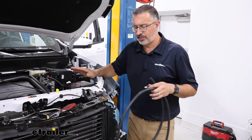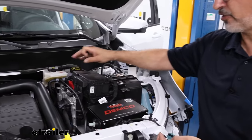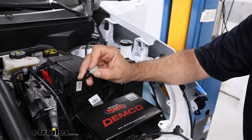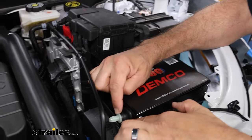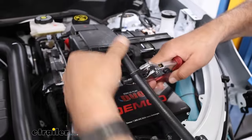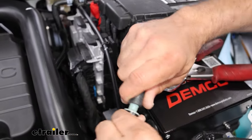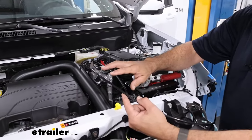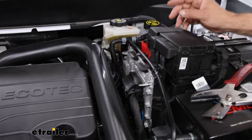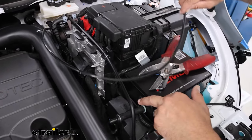As far as the plumbing connections on our supplemental braking system, it's pretty straightforward because we have an electric assist — not vacuum assisted — and the battery remains connected. In your kit you're going to get a check valve. We can either turn the check valve around that's on the main operating unit, which can be difficult, or use the check valve that came in our kit, cut off a section of hose, and reverse it — you want the black facing towards the outside. The other plumbing connection uses the included quarter-inch nylon tubing. I ran this back to the firewall at the same location we ran our wires out for the g-force controller, and it connects directly up to our main operating unit.